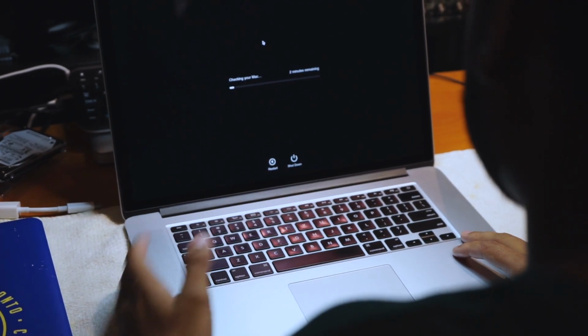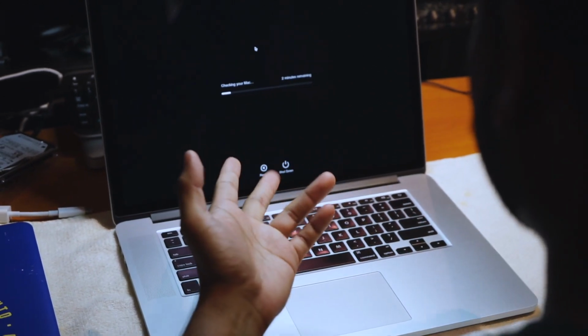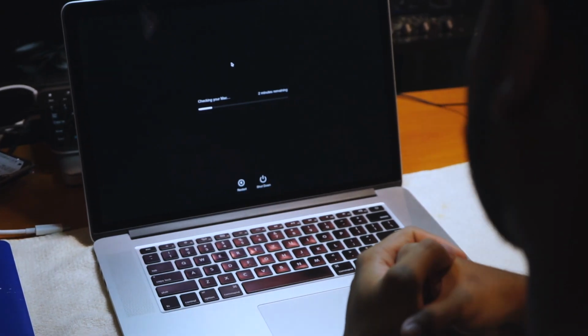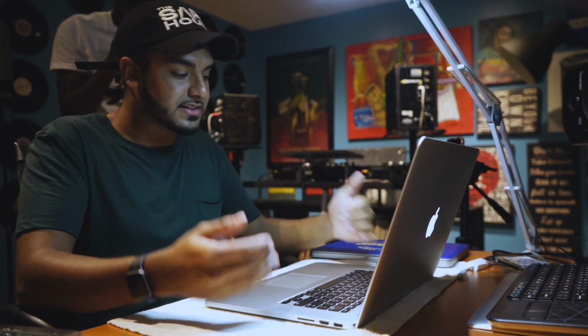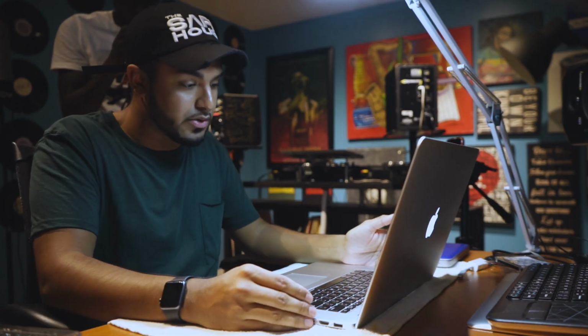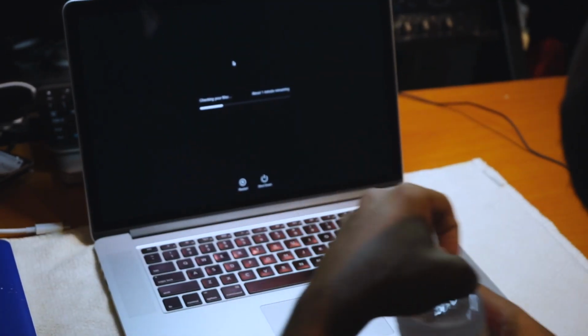This will check the power adapter too. So if the power adapter is plugged in, it's gonna check all of that. Logic board, battery, power adapter, your fans. The fans will turn on and off, they get very high, turn back off. It checks the keyboard, checks for any hardware issues that are in the MacBook. So this is the best thing to do when you're buying a used MacBook Pro off Kijiji or Craigslist or eBay or whatever. It'll take about 5 minutes to do.